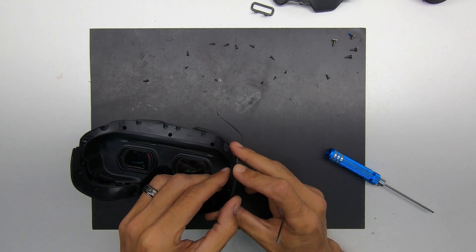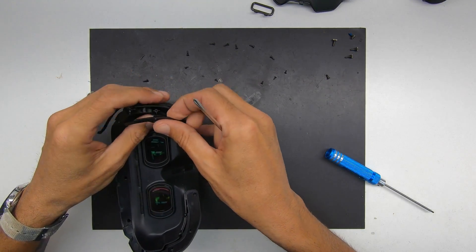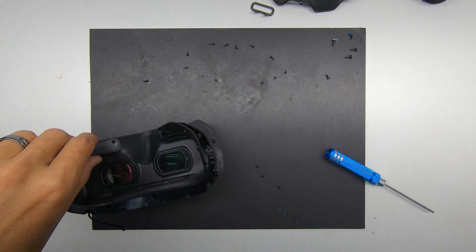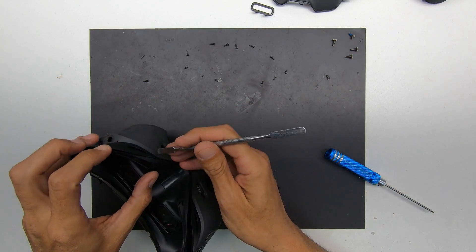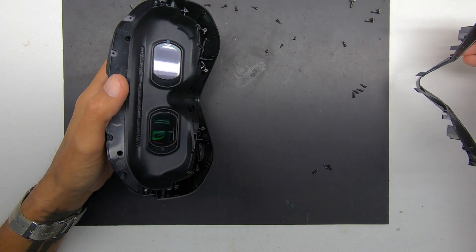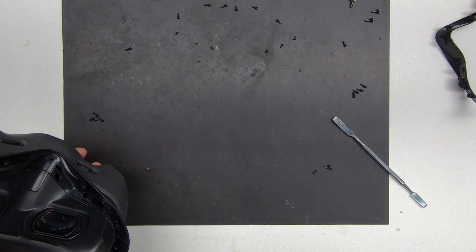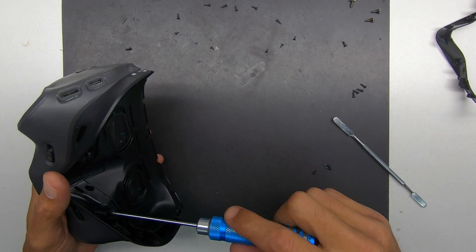What we're going to need to do here is try to get that bottom piece of the bezel popped up. It's just a thin little piece, but there's a bunch of screws hidden underneath there. The easiest way I was able to find is to use just a pry tool to get up under there. Once you take it off, you'll see that there are a couple more Allen screws hidden deep down inside.